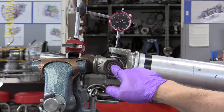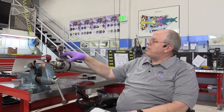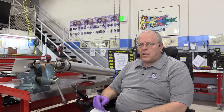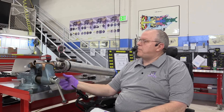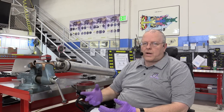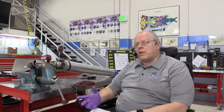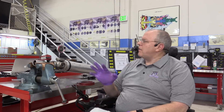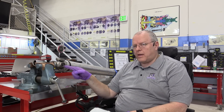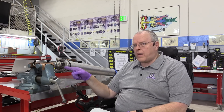On the steel yoke side ears, we have the black 57-thousandths snap rings and 1.5 thousandths axial play. If we had put the 58-thousandths in, mathematically — since we're at 1.5 and increasing thickness by one thousandth on each side — we would have been preloaded by half a thousandth. If we had forced the copper 59-thousandths ones in, we would be preloaded by 2.5 thousandths of an inch.